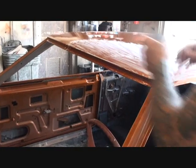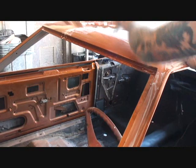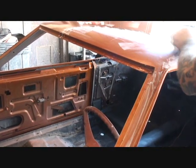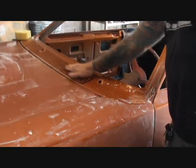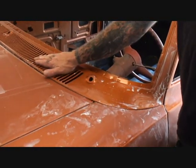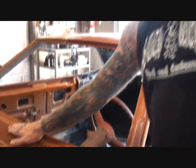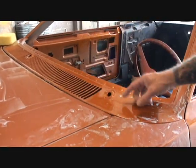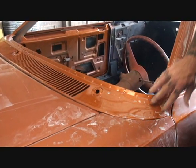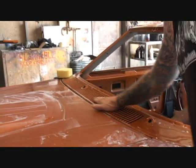Yesterday you saw where I blended this paint in right here — that's all been blended and taken care of. I went ahead and color sanded it down to make sure the blend was going to stay and it looks like it's going to be a nice blend. Charlie was concerned about color sanding and buffing inside the louvers, but we are not color sanding and buffing inside there — that would burn the paint off considerably. We'll only be buffing up to this edge right here.